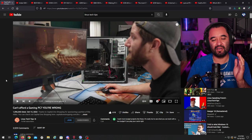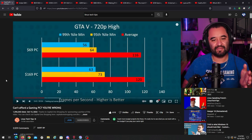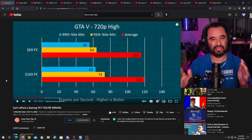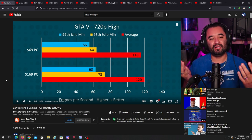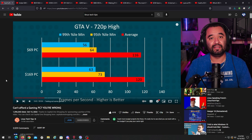I was actually benchmarking an RX 580 in Doom Eternal on high - not ultra. He said high, which is like medium. So RX 580 benchmark on high with the Xeon E5-1620, 4-core 8-thread Sandy Bridge, did manage to get over 60 FPS most of the time. He's showing 720p benchmarks to pump the numbers, but these are definitely 1080p budget gaming beasts. Don't be alarmed by the use of 720p benchmarks - they're good 1080p machines, especially with an RX 580 or GTX 1060 as your minimum GPU.